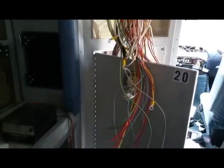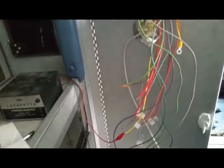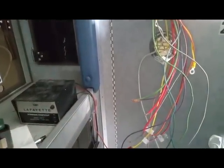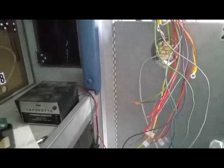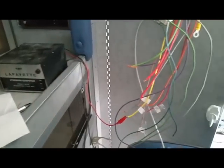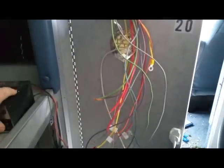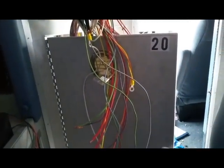Stepping back to the wiring — I've been using a 12-volt DC power supply to figure out which wires go to what as far as the lighting in the ambulance compartment goes. I've been testing and labeling those wires as I go. As you can see here with the lights off, this is an example: I found the wire that makes these lights turn on, and I've also found the wires that control lights on the outside of the unit.